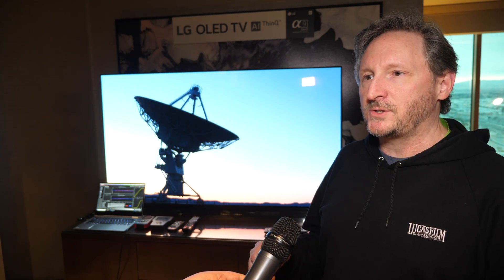We're at an LG event, so let's talk about the LG TV and the input you've had into the TV. Since we started this project, I've been providing LG with advanced copies of test patterns from the prototype stage up until the finished stage. For example, with BT.2020 they changed the location of chroma. Years ago we did an article on the chroma bug, and we've had patterns to identify it. This is a new iteration of that bug — in BT.2020 the location of chroma is different than before, so using the old BT.709 method results in a half-pixel delay, a vertical shift between luma and chroma. LG and everyone else had this problem built into their TV, but they were able to fix it by being given the pattern in advance.